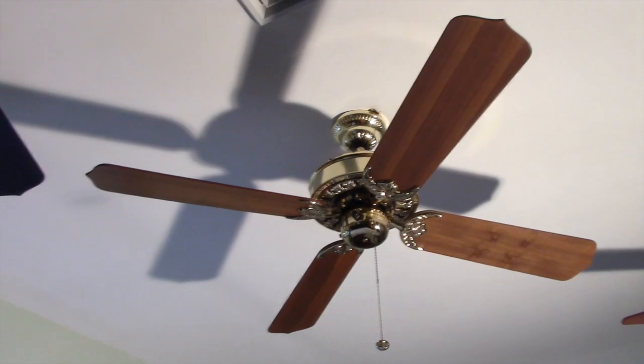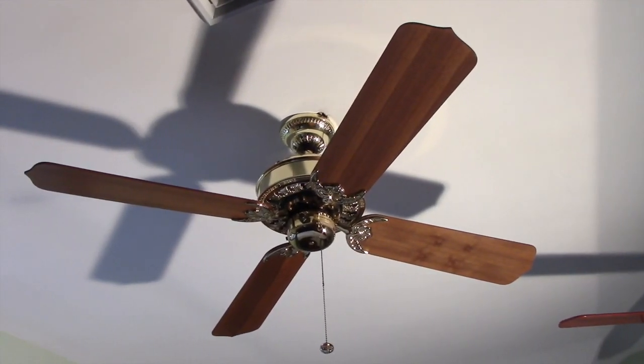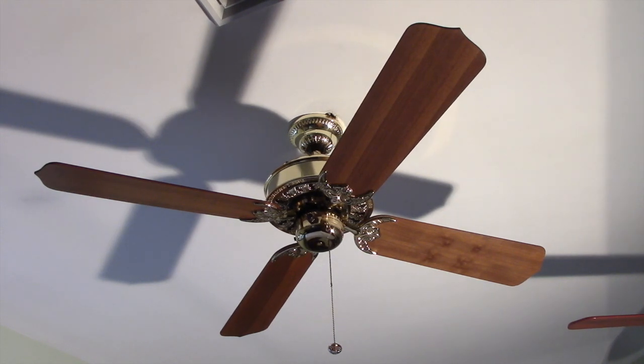This ceiling fan came off of OfferUp recently. And a quick little story about this fan is that when I first got it, the Slumber Quiet did not work. I opened up the switch housing and the board was burnt to a crisp, so I was like, okay, I'm going to have to convert this thing to 3-speed. So, I rip out that board, throw it in the trash, and I did happen to have a spare Slumber Quiet board lying around that had previously been in 2 other motors, and it didn't work in either of those. So I figured, okay, just for experimental purposes, let's put this board into the Cambridge and see what happens. Because in the 2 motors it was in previously, in each of those it had done different things. So, I figured let's see what it does in this fan just for fun.